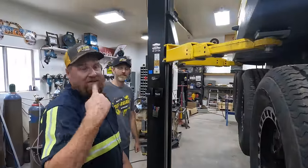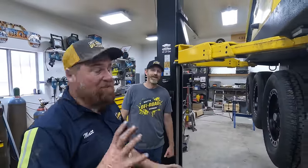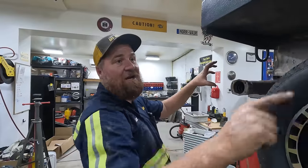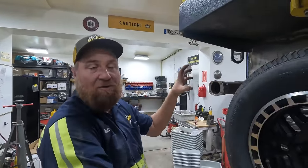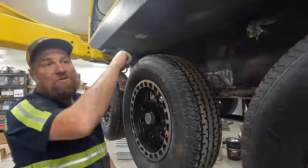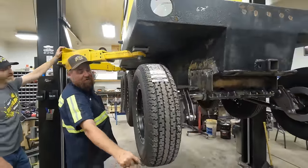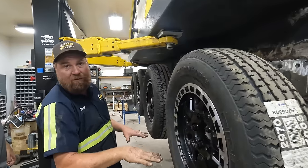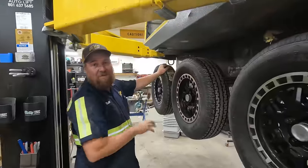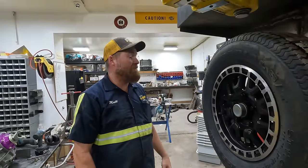A lot of you big brains out there noticed that the drive axle is in the front instead of the back. And the problem with that is when this is driving, it puts tension on the top of the track and the slack goes underneath. To get traction, the tension goes all the way across to here, completely unused, does a 180 degree turnaround before it even becomes useful for work. So yes, we do understand that. The Bombi was laid out this way originally. We're just keeping it that way. It just didn't seem to ever be a problem.